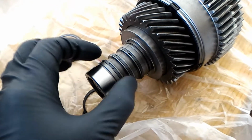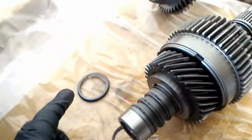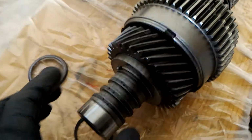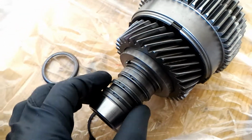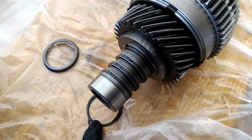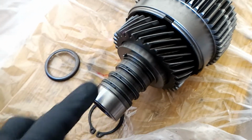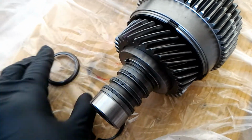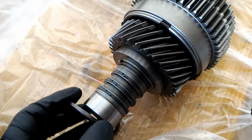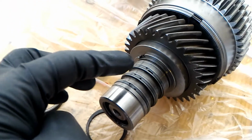The safest thing to do now is take these all off, throw this one away, and I've got the new part over there, and so I'm going to replace this, but take all these off and then put this circlip in first. That way you don't risk damaging these when you slide it over here. So this retaining ring goes back on here, and it captures those half washers or half spacers.